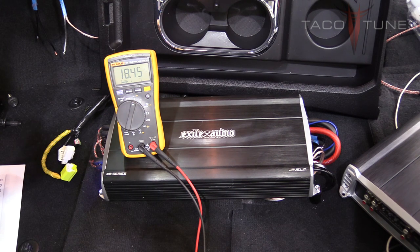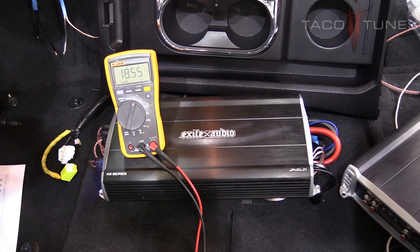We've got the front, rear, and subwoofer all tuned for maximum output with the crossover set at 80Hz. However, this particular customer wants his crossover set at 63Hz for a little more mid-bass. We'll follow all the same procedures but use the 63Hz test tone, which will be available on the site. We suggest 80Hz as the standard crossover point because at 63Hz you risk damaging your speakers at higher volumes. This customer doesn't plan on turning the system up very loud and likes more mid-bass, so we're setting it at 63Hz for him.